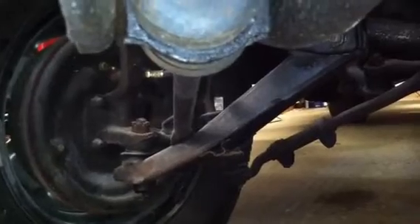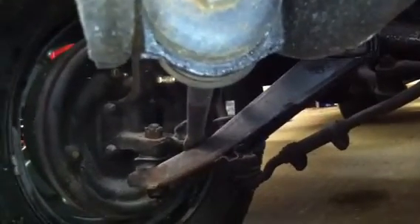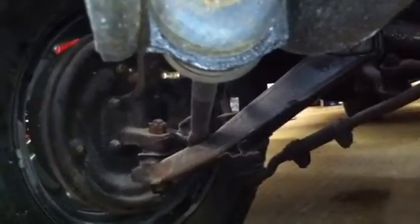That needs to be transferred, along with the piece of frame that it's in, and replaced if necessary. It's a big job. The good news is it's mostly labor — it's a lot of work, but it's certainly something that you and a buddy could do in a weekend. You really need to get someone that's competent with a TIG welder to weld in that new piece of frame.